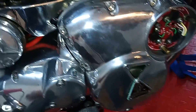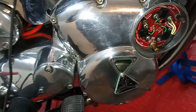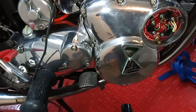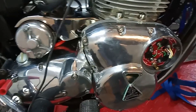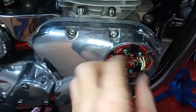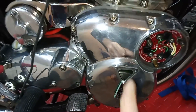We've opened the little timing inspection aperture and there's a needle there — that's part of the screw — and that needle is exactly where we line the timing up. We're going to start the engine and rev it. People often ask where to rev it to — basically you rev it until the line stops moving, which happens at about three and a half to four thousand revs. At fully advanced, no matter how hard you rev it, it won't go any further.